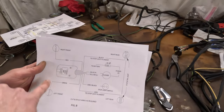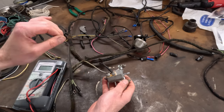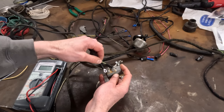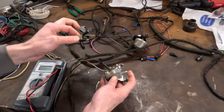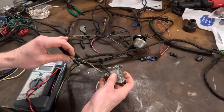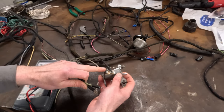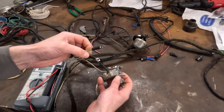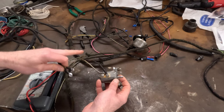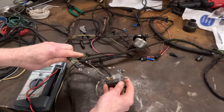Here's where things can start to get a little confusing. This is your brake light switch. On the old harness, both terminals hook up to it — power in from your headlight switch and power out to your brake lights. Very straightforward. If you are running turn signals, you only use one of these. You still need power in from your headlight switch; however, the wire that comes off of this going to your brake lights you no longer use. Instead, you run that wire back up to the turn signal switch, which feeds through and back so you'll have turn signals.